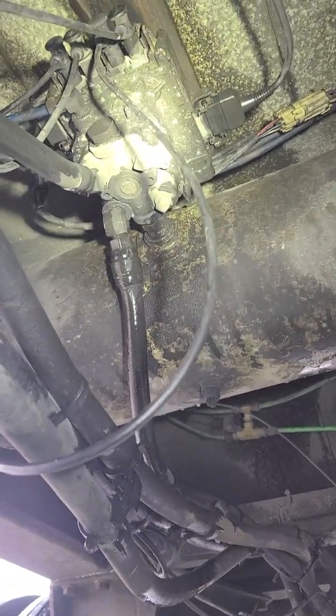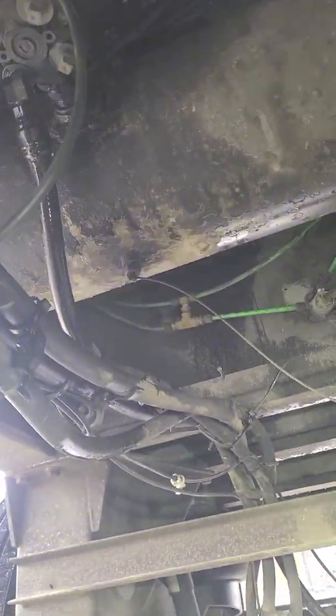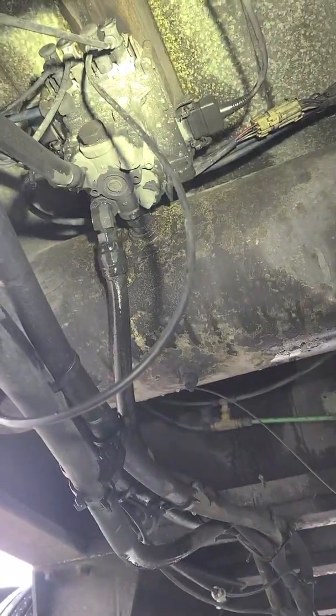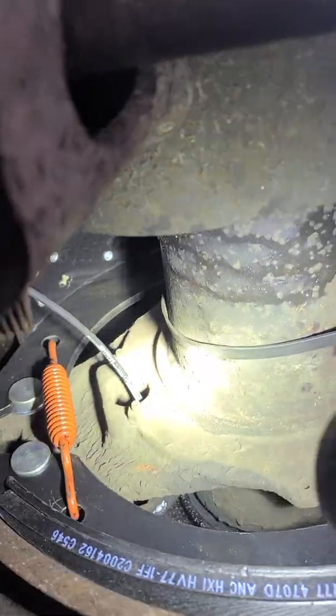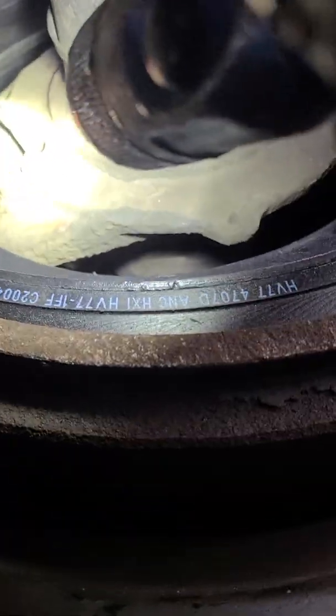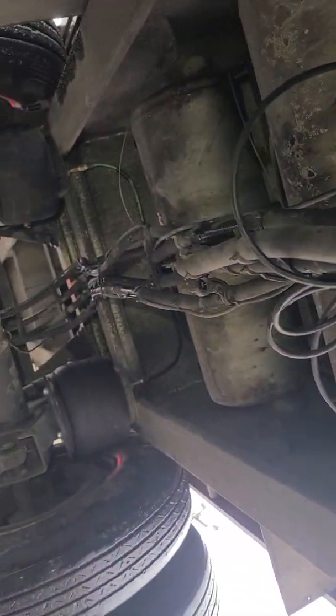We have to work with ABS — we got an ABS light on. We're going to go over some troubleshooting steps. First, you're going to find your actual ABS wires and your ABS sensors. Watch where they run and visually inspect them all the way up to your ABS. You might have them on the axle up front or on the axle back here.